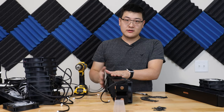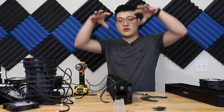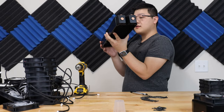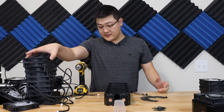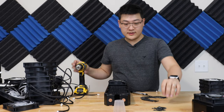I actually can't put the bottom fans onto the radiator right now. What I need to do is put the fans into the case and put the radiator on top and then drill through the case. So we'll put this one on the side for now. This one is gonna be the one mounted to the top, so what I can do is mount the fans that are gonna be on the pull side — the ones facing the bottom.